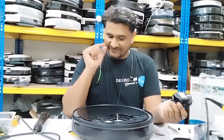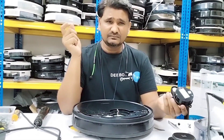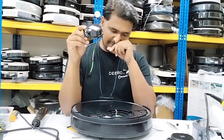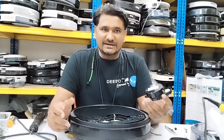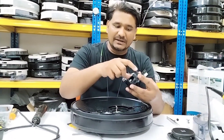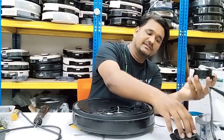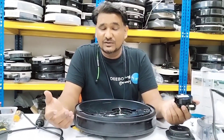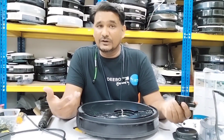Welcome to Qwax technical support. Today we have an Osmo 950, and the customer says the robot is giving an LDS error — the LDS motor function is not working. Some customers receive messages asking about this: they say the LDS looks okay physically, the belt is fine, nothing is stuck, and sometimes the LDS can even turn slightly when they look underneath the cover. But still the robot is not functioning. So what is the reason, and how can we detect that the LDS assembly is faulty and needs to be replaced?